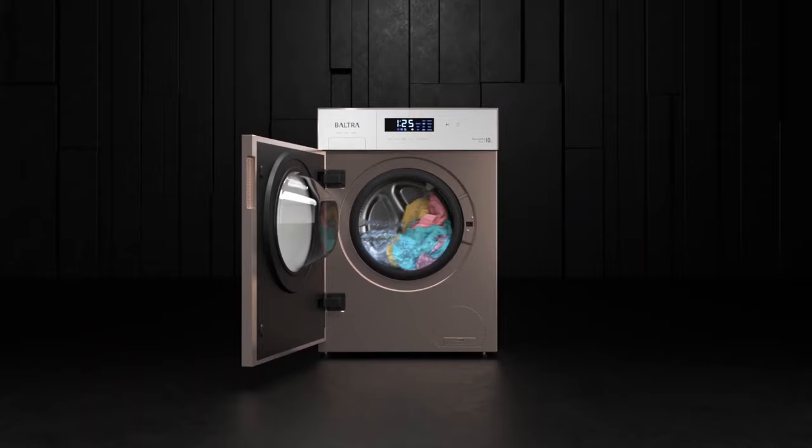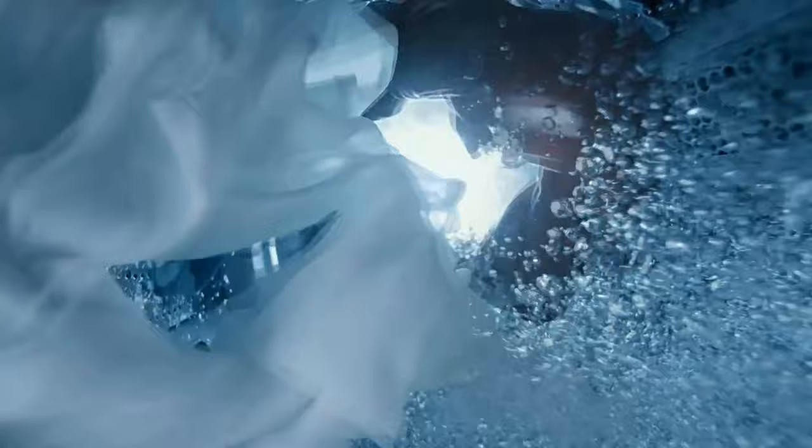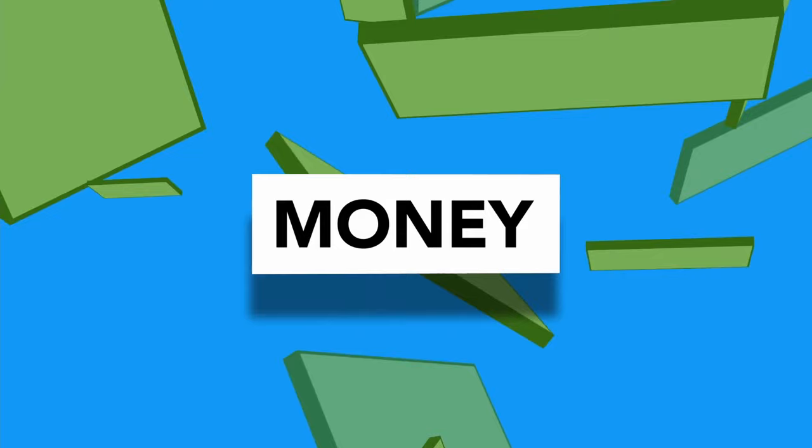The rotating drum is the main area of difference between top load and front load washers. In top load washers, it's an agitator in the middle that spins rather than the drum itself. The agitators are screw-shaped, causing the clothes to be lifted up and tumbled around. The main benefits of top load washers are that they are simpler, easier to use as there is no bending when loading and unloading, and they have a lower initial cost. However, they use more water as the full drum needs to be filled, they are also louder and less energy efficient, meaning the lifetime costs can be higher.